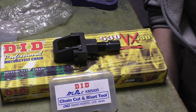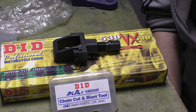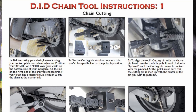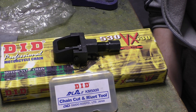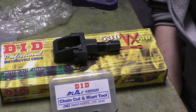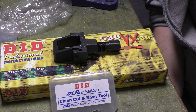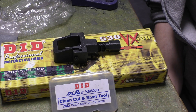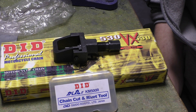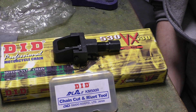Number one: people are saying don't you have to grind off the rivets? No you don't, that's the whole point. If you look at the actual instructions from DID, they say no, it doesn't really matter. Some people are saying you really want to split the master link — yeah, you can do that. I was just showing how the process works, not exactly what link you want to go for. If you look at that piece of chain I have from the XJ, I did remove one of the master rivets — basically they're a bit weaker than the other ones. Someone asked: does forcibly pushing it through damage the rivets? No, not really, because it's under compression.